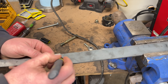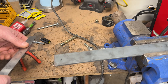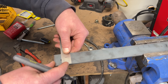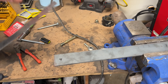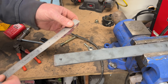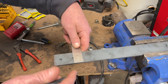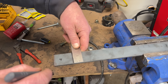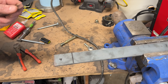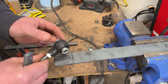Now I just transpose all of my measurements onto my bolts. I like to come in five-eighths of an inch to give meat to the other side. I'm using one-and-a-half inch, three-sixteenths thick flat bar because we're really beefing up that strength. From the intersection it was one inch, so our hole is going to be there — one inch away is going to be where we cut it off. That's why these are adjustable: if we don't get it perfect, we just unbolt or bolt it in.